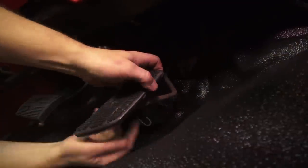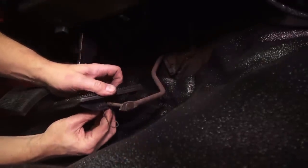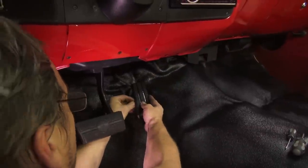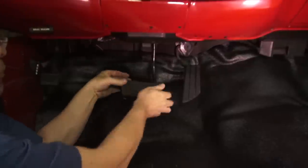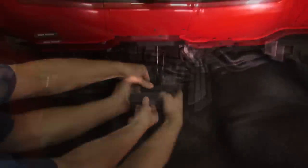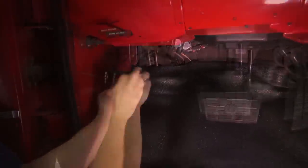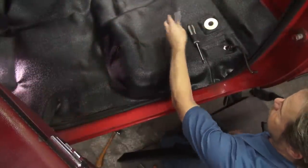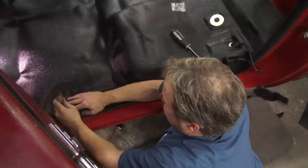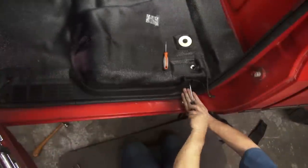Since we're in here, we're replacing the gas pedal with a new one so it matches the new flooring. It's as simple as removing the retaining clip on the left side of the pedal arm, releasing the retaining spring, replacing the plastic pedal, and reattaching the spring. Don't forget the retaining clip on the other side as well — this is easy to do using a three-eighths deepwell socket to press it on. The power brake and parking brake pedal pads are easy to remove and replace. An awl is a great way to locate your screw holes without a lot of drama when replacing your sill plates — just put the plates where they belong and gently push the awl through the hole until you find the original screw hole in the floor. That way you don't have to drill another set of holes, then simply screw in the new plates with the provided hardware.